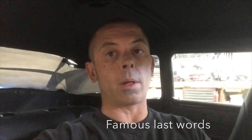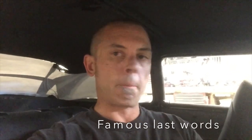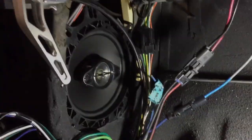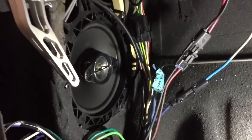Most of the 6x9s being in the decklid should be able to get some sound out of this thing — it should sound pretty good. We're still waiting on the subwoofer, another amp, and the head unit, and that stuff probably won't be here until next week. I'm not going to build the sub box until I get the sub here — I want to make sure everything's mocked up in cardboard or something before I build it. We got one of those 6.5s mounted in the kick panel there, flushed back so it'll be behind the upholstery as usual. One more side to go.